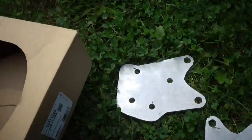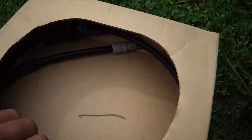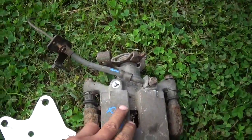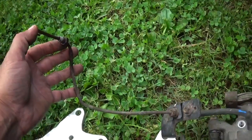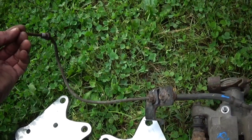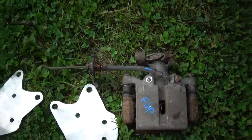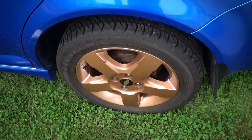I had to order new parking brake cables — this is a Cobalt SS parking brake cable that should fit directly in place inside the car, though I do have to remove the seat to get to it. The brake lines where they hook to the car are identical on both models, so I just needed the SS brake cable setup. Get the wheel removed and all this stuff installed and it should be a cakewalk.